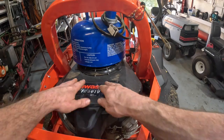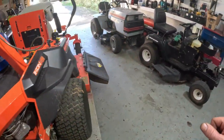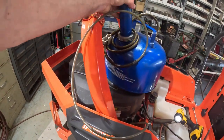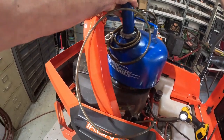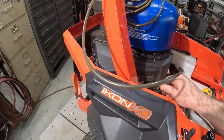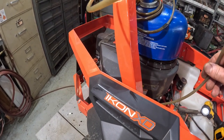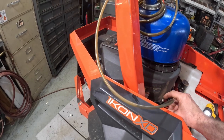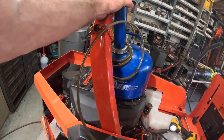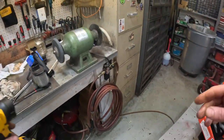Okay — there's the air filter and spark plugs done, got the new oil filter on it, got the fuel filter changed. Let's see how the oil is doing. When this thing is empty you'll hear it just start slurping air — just like that. That's kind of cool, like a warning signal. And don't pump this thing too many times — you can implode that can. I've seen it happen.